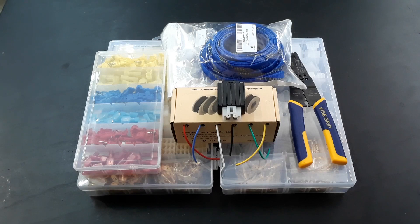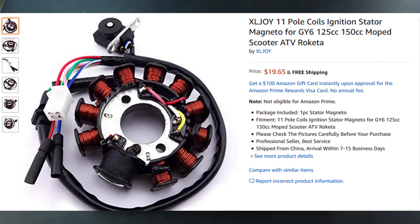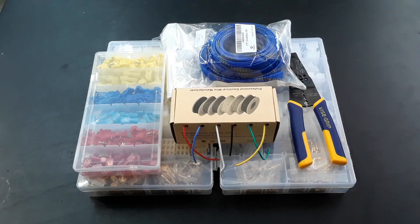There is a way to do this without buying all the extra stuff I have here. There's even a video online where an electronics guru was able to turn his 8-pole stator from a half-wave to a full-wave system. But for my situation, the original regulator needs to be replaced. This is the regulator I purchased from Amazon and am currently using on the bike. Along with that regulator rectifier, you obviously have to purchase the 11-pole stator. For all the items I'm showing, there will be links in the description.